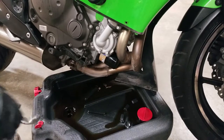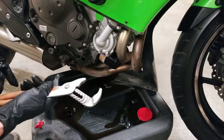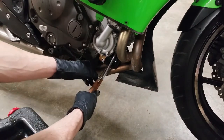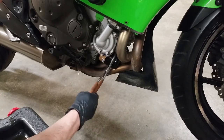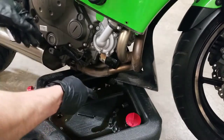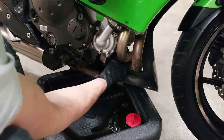Now that the oil has drained, it's time to remove the oil filter. This is located right here. This shouldn't be so tight that you have to get a tool, but if it is, like mine, you could use a pair of channel locks. I'm going to turn it just until it breaks because the gasket is really sealed and glued to it, so I'm just going to turn it until I feel it break. Once it's loose, put the oil catcher directly underneath it and then finish removing it by hand. There will be a lot of oil dripping out of here, so just keep that in mind.